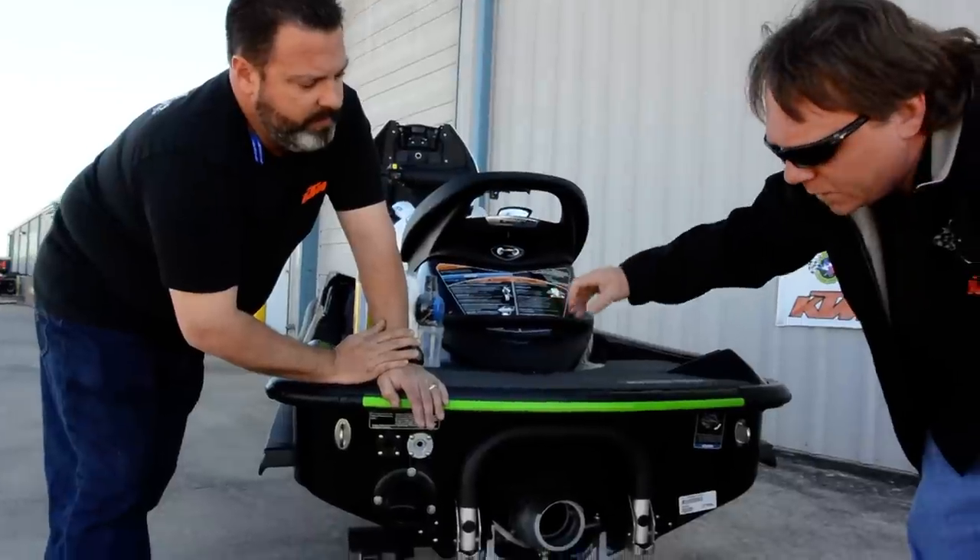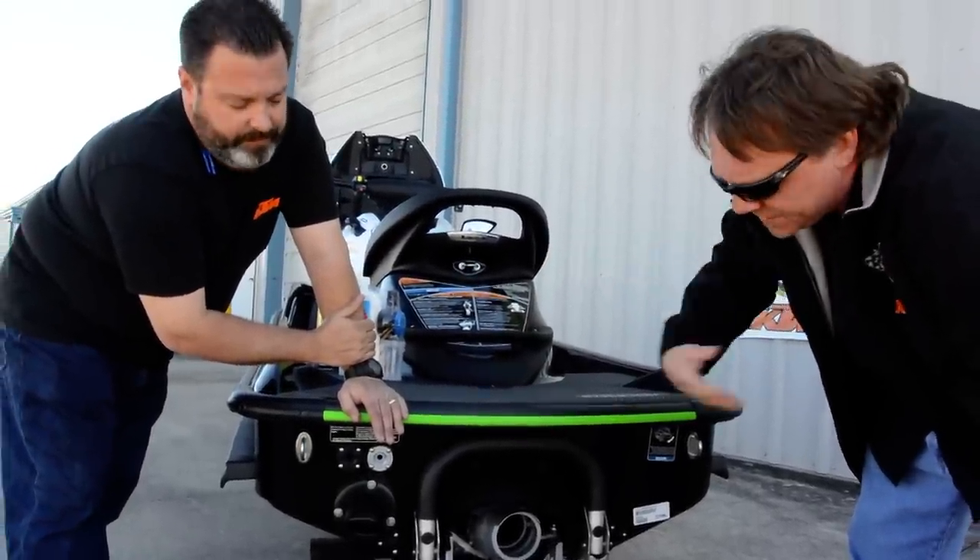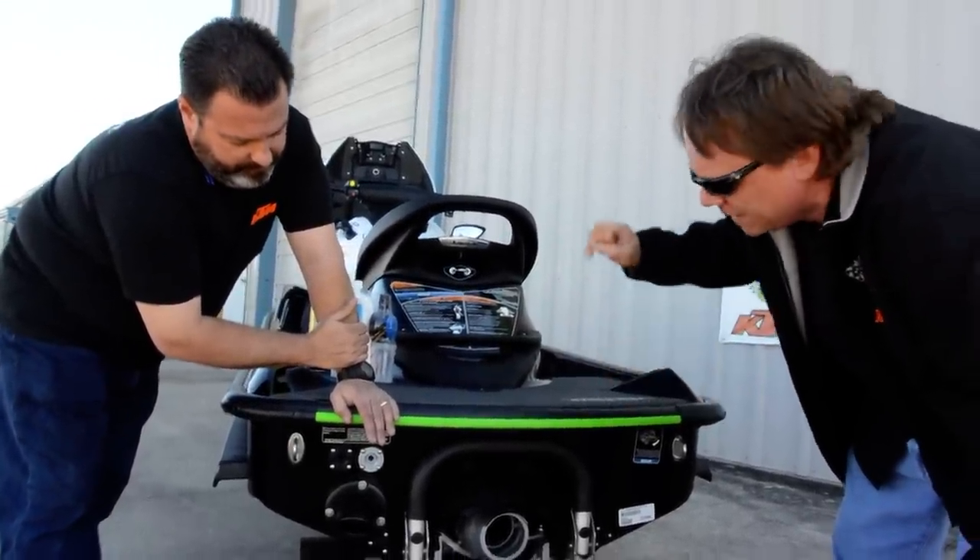It's good to give it — after you've shut the water off — let the engine run for 10 or 15 seconds, then give it a couple of revs just to push any excess water out, and then shut it down.